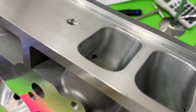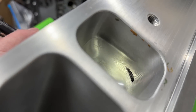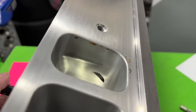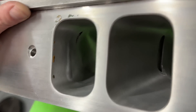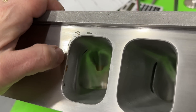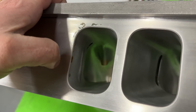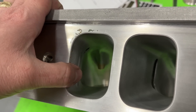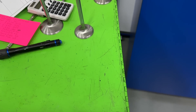At the pushrod area - I measure across and up/down. The long runner is 4.21 and the short one's 4.13. You might ask how that's possible. If you look at the port, there's a lump right there. That bump is because of the pushrod slot. My thought is they probably did some grinding and realized there's not enough in the casting - if they made it a perfect round blend it would break through. Probably the casting was moved over too far, so they left a little bump there. Not a big deal at all.